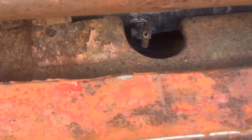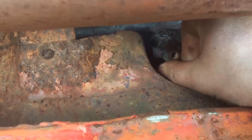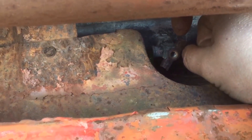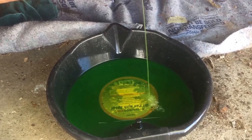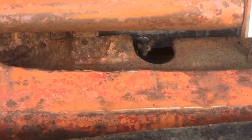I'm about to drain the radiator. There's a little valve right here. Turn it out a little bit and we've got to drain it into this pan. Pretty simple. We'll flush it and refill it.